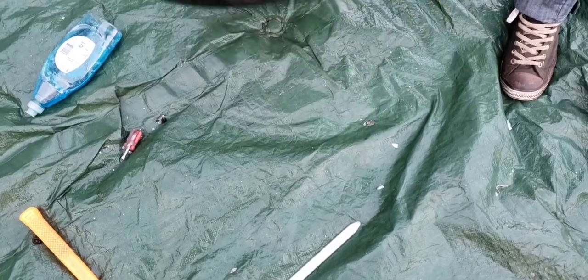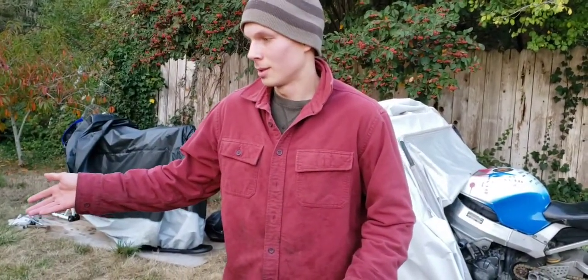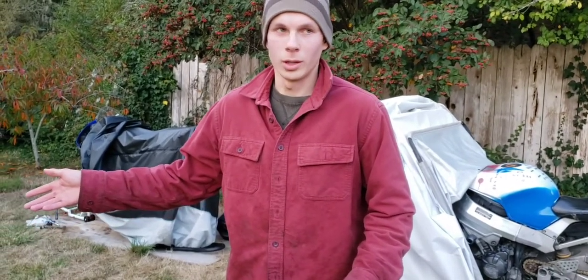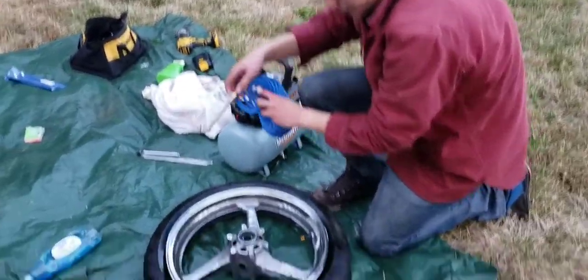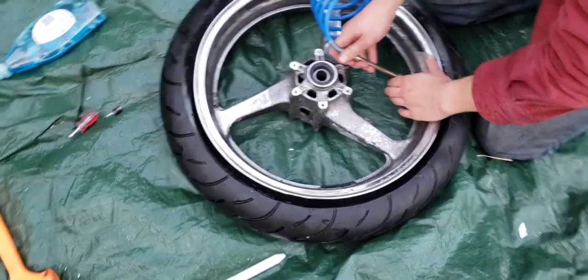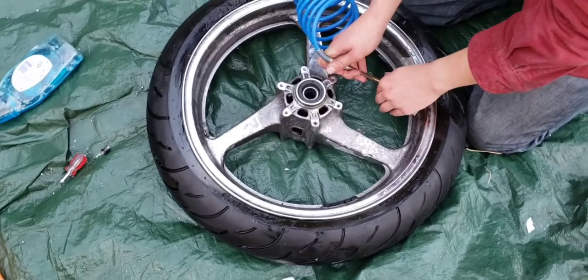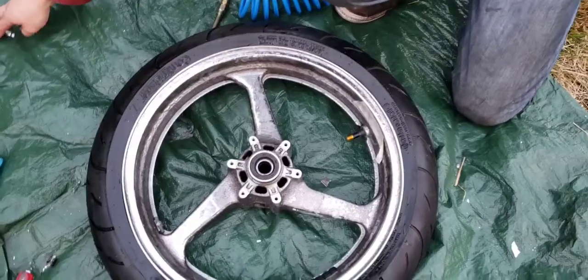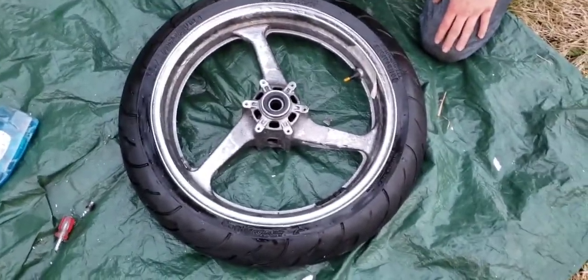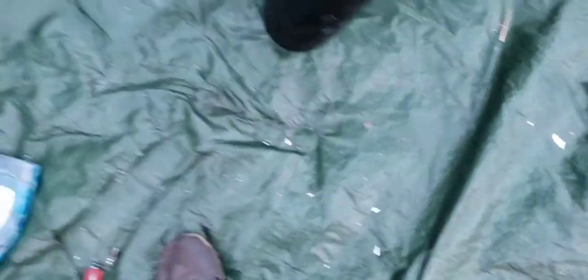We don't really need to add any soap at this point. Now we're just gonna fill it up to 60 psi. Filling up the air compressor — I really hope it seals both beads without needing starter fluid. Add air — it's gonna pop twice as the beads set. Beads set pretty easily. We're gonna fill it up to 60 to 80 psi so we can see if it's leaking. It's at 60 psi. Now we're gonna spray around the valve stem to check for leaks.